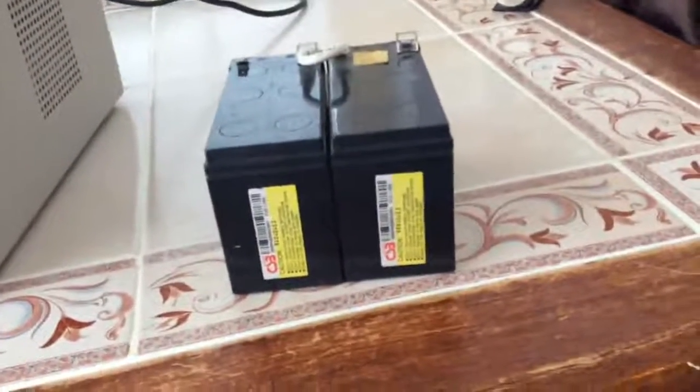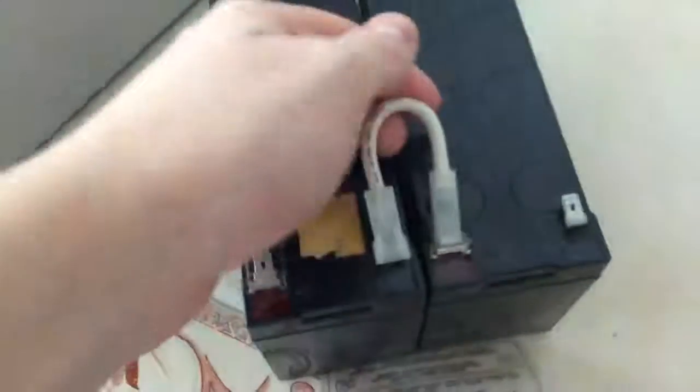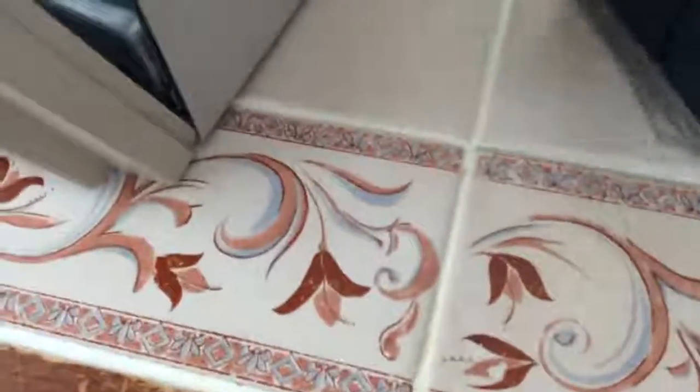The old battery set: this one takes two 12-volt, 7 amp-hour batteries. They're wired in series, I believe. This is the original battery — you can read right on the bottom. It has a date code of March 1998. I guarantee that's a 3 it's pointing to, so March of 1998. These are going on 18 years old now, so yeah, definitely bad.